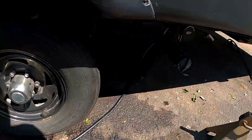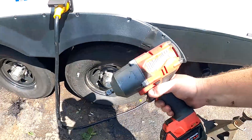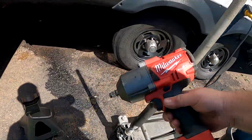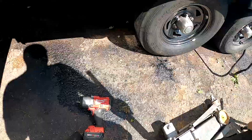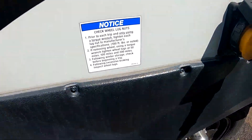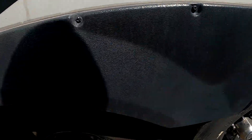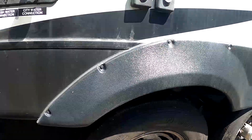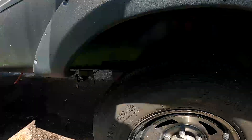I love using these cordless impacts. This particular one is a super powerful Milwaukee — it's rated up to 1,400 pounds. We're working on a camper here that has a max torque spec on our wheels of 100 foot pounds, and I went ahead and zipped all these lug nuts down when I was doing the bearings to the first click.